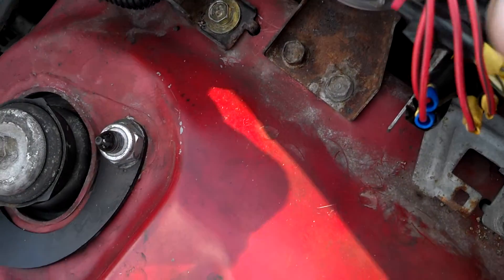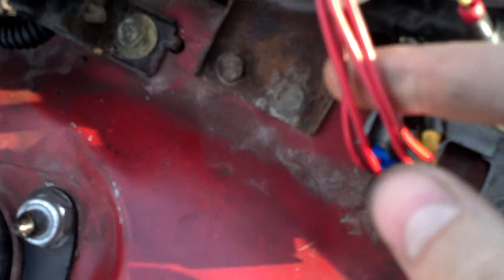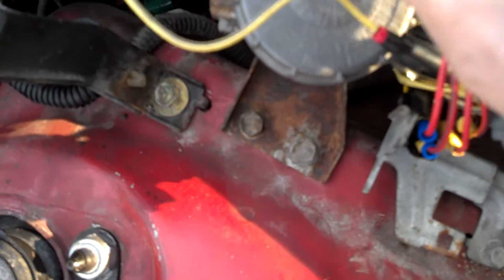What you do is you actually cut those wires off the pigtail directly in half. You've got the bottom three and the top one — as you can see, I've already done so, and it's completely separate now. You cut them off, wire them all together, and this one yellow wire runs straight to the low impedance module. The red wires — it does not matter what order you wire them up in, as long as they all go to the injectors.